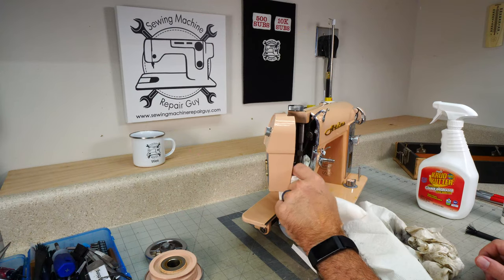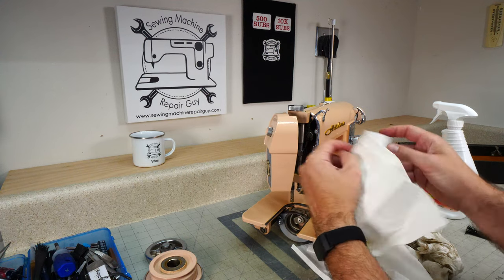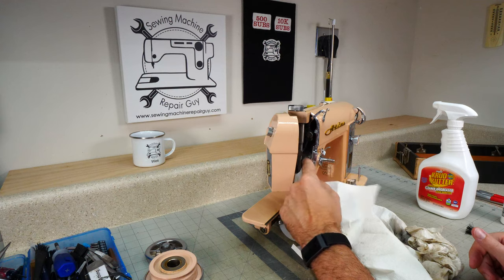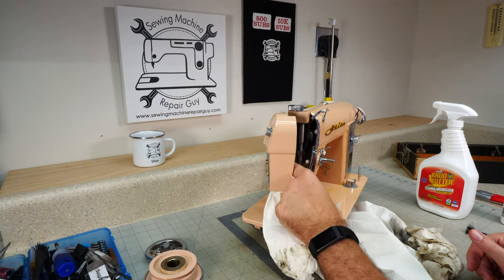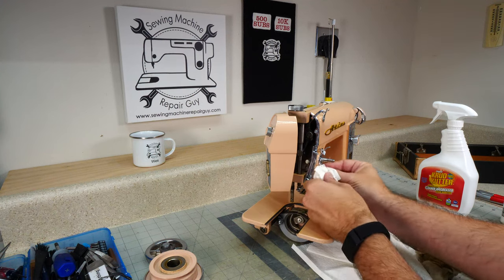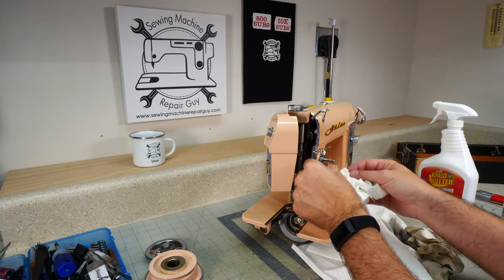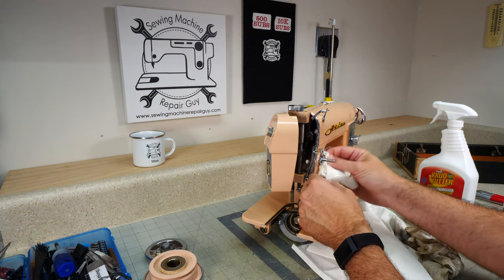And you also have to make sure that you oil this machine because you have just cleaned out all the oil that was on those mechanical portions. For the rest of the machine, the outside, I wipe off the crud cutter and then I'll put a really, really thin coat of oil over the whole machine to protect it. And just some way to make sure that that crud cutter doesn't stay on that paint, because it will affect your paint if it stays on there too long.